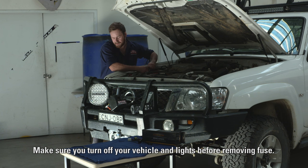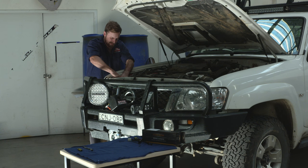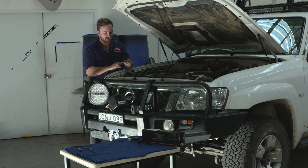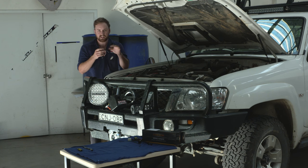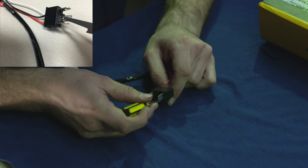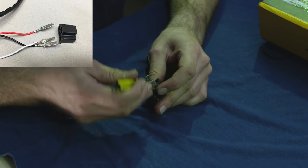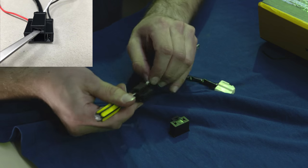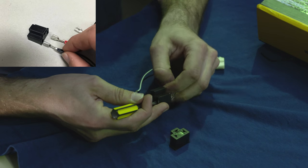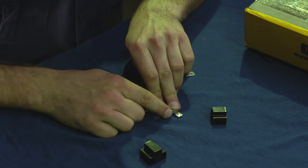The second thing is to remove the piggyback adapter connected to your headlight — that's just this little piece here. We're going to take this over to the bench and have a bit of a play around. All you'll need is a small flat blade screwdriver. Pop out all the terminals by inserting the tip down these slots and gently levering the small tab back. Pull the terminal and it should pop right out. Do that for all six terminals and then pop them back in in a different order. Use your screwdriver to fold the tabs back out a little if they're flat, and then add them back in.